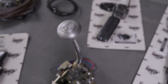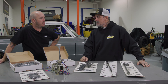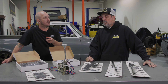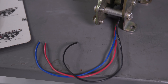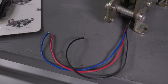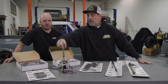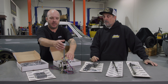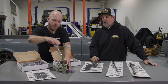Rob, you mentioned you've got a 4L60E transmission in this truck, which is not normally what the big blocks came equipped with. That leaves us some options for our shifters. We're going to be using their fairly new automatic electronic sport mode shifter, which is essentially their automatic shifter in regular mode, but it also offers a bump shift option. So we're pulling it down into drive, bump it over, and then we're up and down shifting.